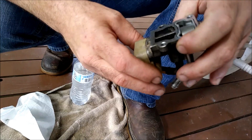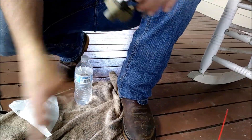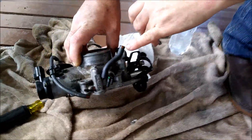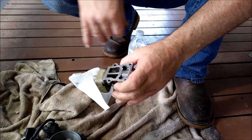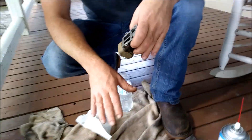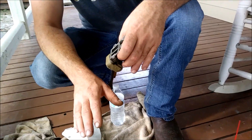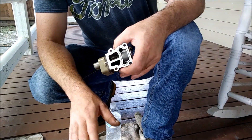This is the 1MZFE — they quit making it in 2004, 200 horsepower V6. We took the throttle body off because you have to remove the throttle body to get to it, and we marked all our vacuum lines with paint to match them up. The car was idling high and staying at a high idle, then idling erratically after that periodically, but we only noticed that after we cleaned the throttle body with carburetor and choke cleaner.